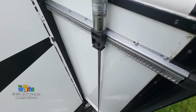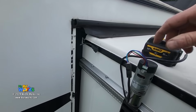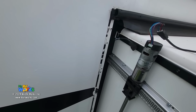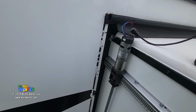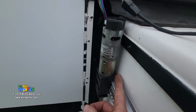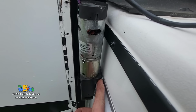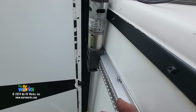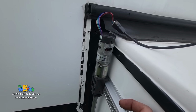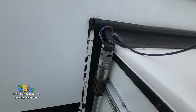I'm going to make sure everybody's happy. Sometimes I'm having issues with touching the wrong buttons. So I'm going to pick up where I'm moving back, make sure everybody's happy. And I have even seen where sometimes these screws, if you look right in there, they don't give you much room between the screw head and the bearing block. So sometimes these screws will stick out and that'll be a hard stop. This thing will get caught up on those. We've seen that several times actually, and a lot of broken off screw heads. So anyway, moving along here.